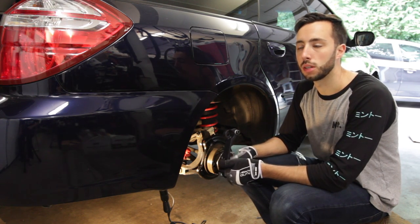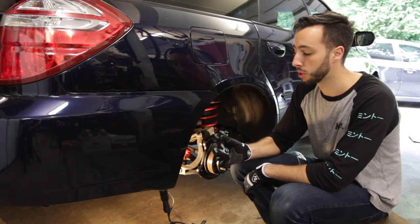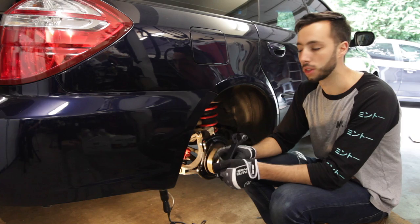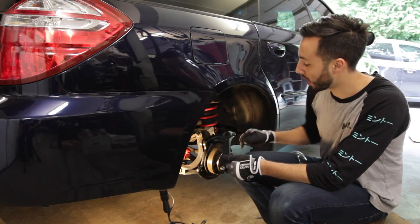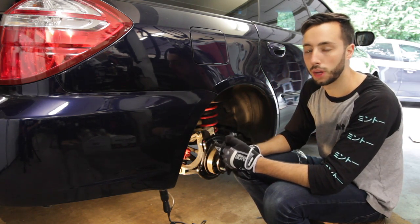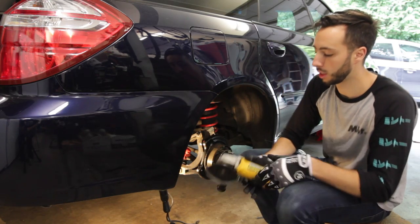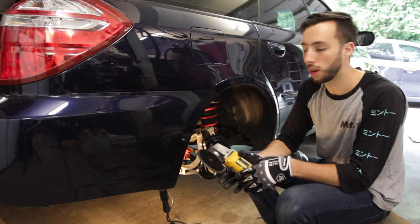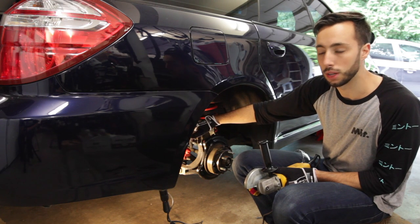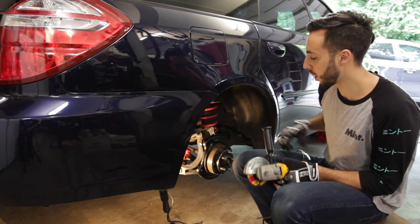In order to fit the rear Brembos on the back of the Legacy, you have to use an adapter bracket — this one is from K&S Brakes, and they make one for most applications. This is the V1 bracket. Once you mount the bracket, you actually have to shave away a little bit of metal off the arm behind it, just enough for the bolt head to sit there and clearance it. The best tool to get that started with is a grinder with a cutting wheel. Mount your bracket where it would go and mark with a Sharpie where you need to make cuts.